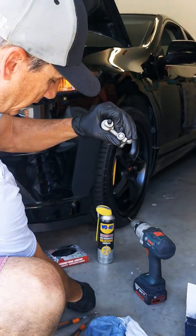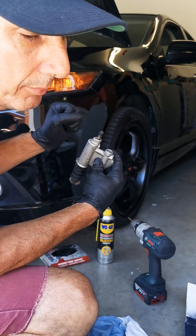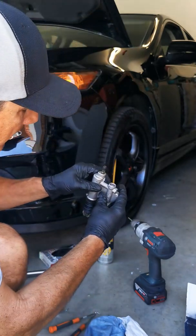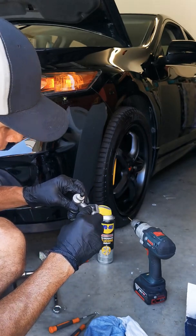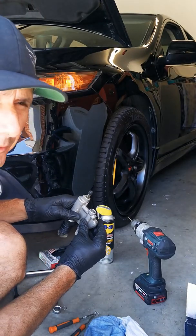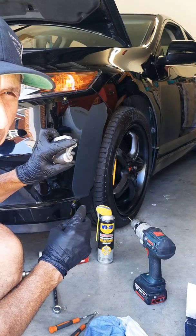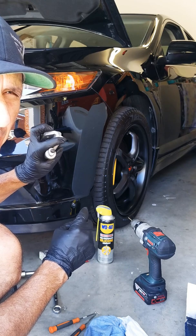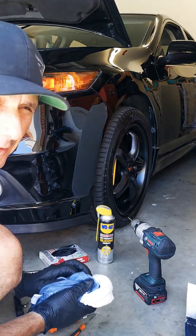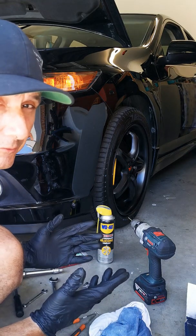Then with a pair of pliers you pull out a little cap, and behind that cap are two parts — a little plastic filter and a black plastic cap. Those two parts are the bits you discard. Then all you do is replace the cap, put the c-clip back in the channel, and reassemble your slave cylinder. Put it back onto the car and with fresh DOT 4 fluid — three or four I believe can be used in the Accord Euros — you just bleed the system. You can either gravity bleed it or get somebody to pump the pedal like you would with brakes.